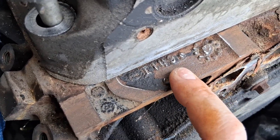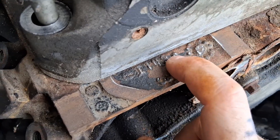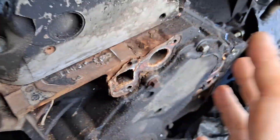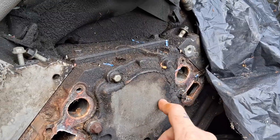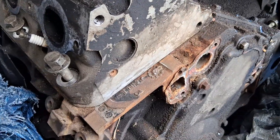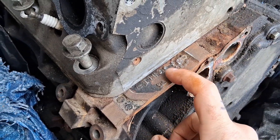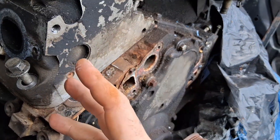The last is the year number, but don't be confused — Gen 3 ended in 2007, and this says 9. We don't have a Gen 4 because there's no cam sensor on the timing cover, and the knock sensors aren't up here; instead they're in the valley cover where they get ruined.